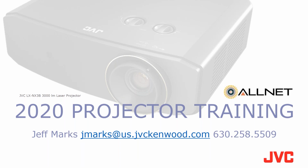And the other thing is that the gain on a lenticular screen is a negative gain. So while these projectors are 2,000, 2,200 lumens, a negative gain actually gives you less brightness. So therefore, you're not getting what you think you're getting. You're getting less brightness in an environment where you want to have more brightness.